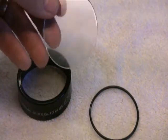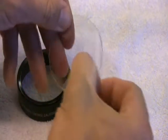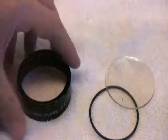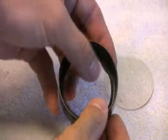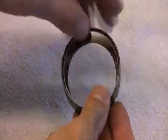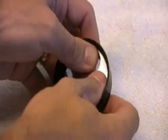With the LED bulbs, the flashlight doesn't burn nearly as hot, and you no longer need the glass reflector. So it's no longer at risk for shattering if you drop the flashlight. Just drop the O-ring into the cap, and then push the new reflector into the cap. And it's ready to go.